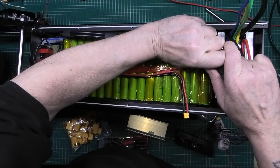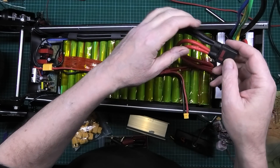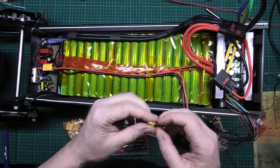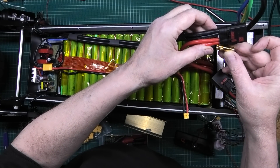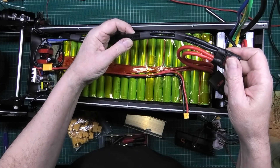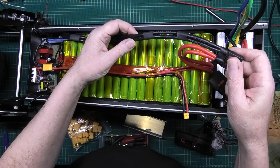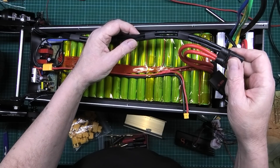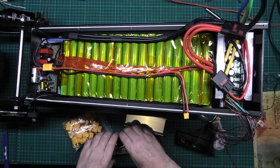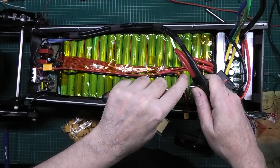The QS8 which I've got to change anyway because I've burnt it — I'm gonna have to put an AS150 on there. I don't know how, it's gonna be very very tight. I can't just make do with one 8 AWG — I need to keep the voltage drop or voltage sag to an absolute minimum. So unfortunately this has got to go.